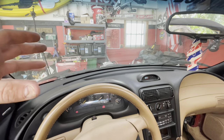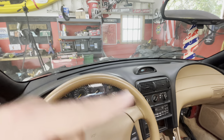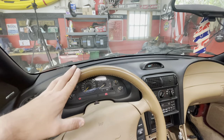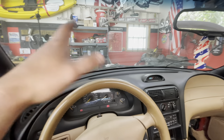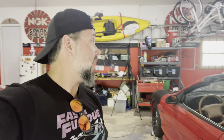I wonder if I'm simply out of gas. Before I waste three hours diagnosing stuff, I'm going to run to the gas station and get a few gallons. If that doesn't fix it, then I'll get out the compression tester and check compression in the cylinders, because we did change the cylinder heads — who knows if we have bad heads or gasket issues. So we just got four gallons of fresh fuel, 87 octane, poured in. Four gallons should make it run if fuel was the issue. My guess is it's probably not going to fix it — I'm thinking maybe we have either an ignition timing problem or maybe we don't have compression. Still crank no start with the gas added, though.